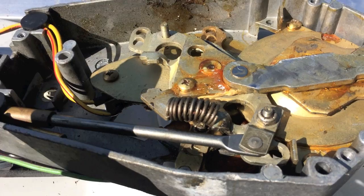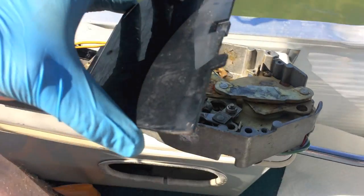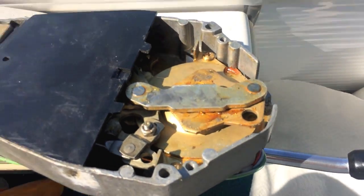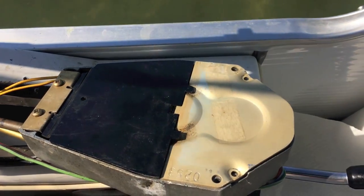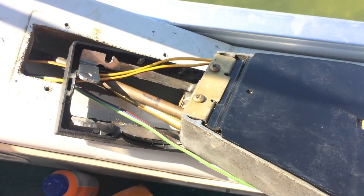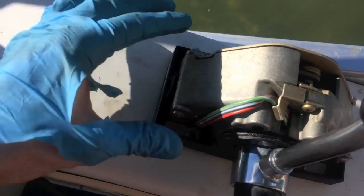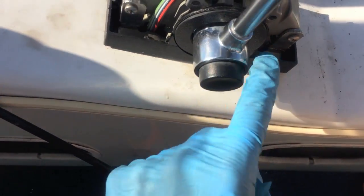I'm going to put the throttle cable back in and secure that on its bracket. Cables are secure. Let's go ahead and reinstall the plate. This little plastic clip goes on here and then you have a plate that has grease on it — that's what it will look like going back into the actual housing. From here it's just reversing the steps, putting all the bolts back together and securing the outer plate.